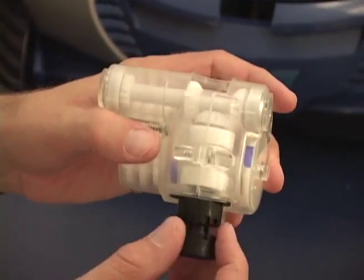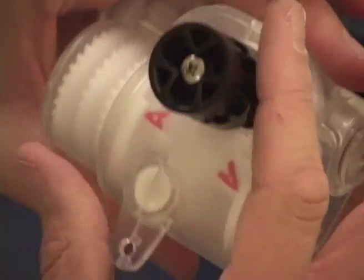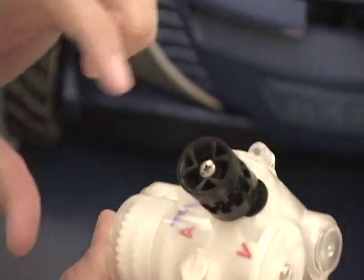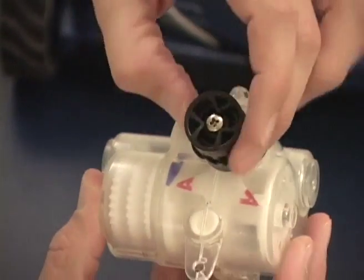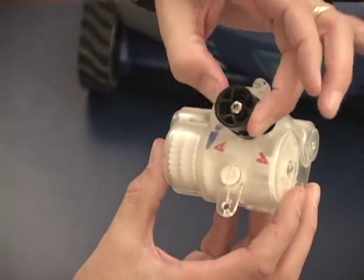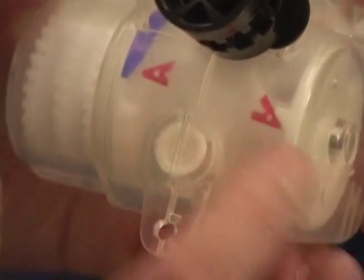You'll get into the neutral position where it doesn't actually drive. The other issue we can cause is if we drive the pulley in the wrong direction by turning it clockwise, it will make the whole system work in reverse. The problem with that is our cams are moving through the pivot in the wrong direction. When we get into this position, we're putting a load on the system. The cams are made to slide past each other in one direction, and when we go the other direction, it can lock up the system. As I'm turning this pulley, I can feel there is a load being put on the system, and eventually we will break the little teeth on the cams or on the pulley.